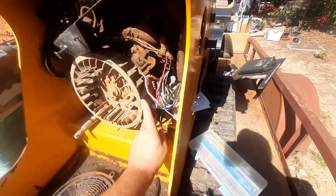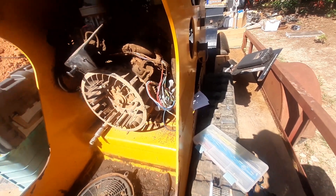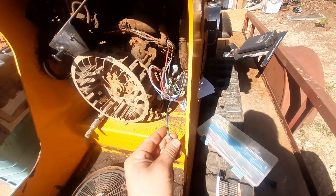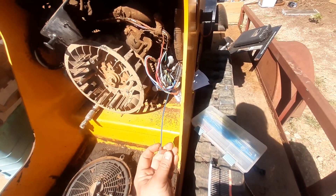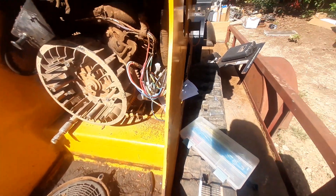After that, we still had problems. Starter turned out to be bad. The brand new starter they just put on was actually bad, but I also had seven or eight volts coming up through this. This is the wire that actuates the starter solenoid — it's the signal wire, basically.